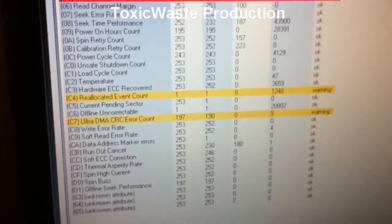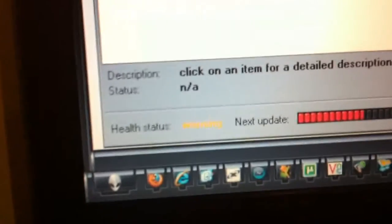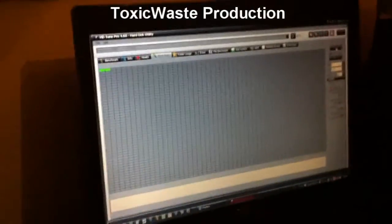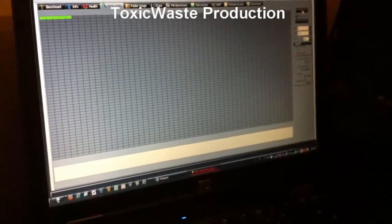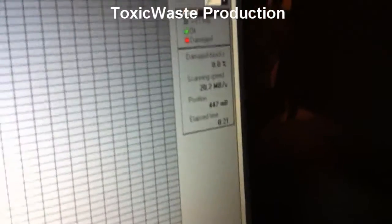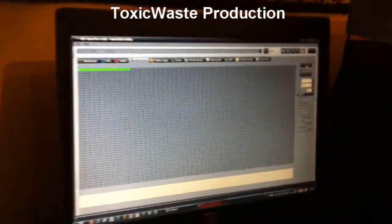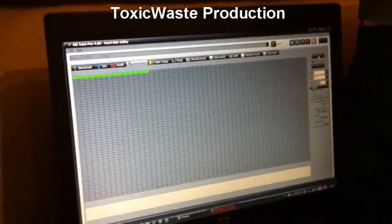It seems like I'll send the drives back. There are too many problems - you can even see the health status says warning. But just for fun, let's do a scan on it and see what it says. I'll update with this or put a comment on how the scan went when it's done. At least this one scans faster, so that's a good sign. It should be between 25 and 30 megabytes per second - it's at 20 megabytes per second right now, so it's not bad but it's not good. This case does 30, so good drives usually do 30 in this setup. Like I said in the previous two parts - please subscribe.